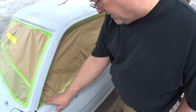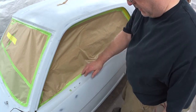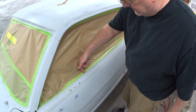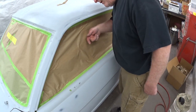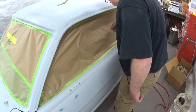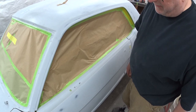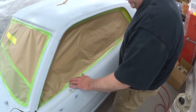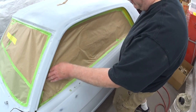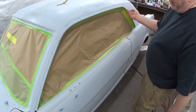I'm trying to glean enough information that I can apply it to my own situation and come out on top of this thing, hopefully. As you can see, same technique here. I back-masked underneath the lip here, because I need to put paint right there, so I need to be able to get my gun at least reasonably over the top.